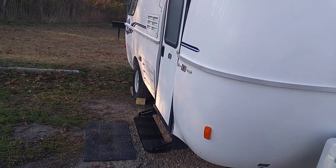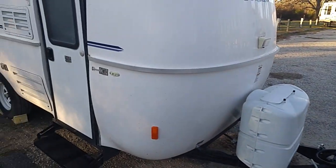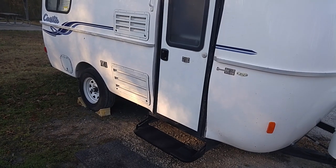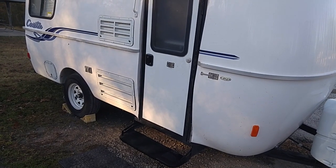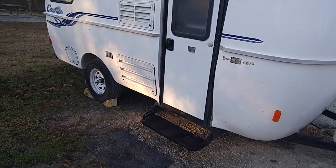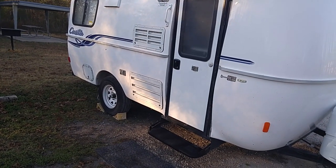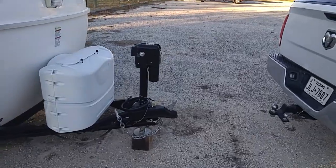The last thing: be sure you're hooked up to your truck — be sure the hitch is hooked up to the ball — before you remove the chocks. Even though it looks fairly level, if there's any incline a single-axle RV can cause you a lot of problems because it'll move. So just leave those little yellow chock blocks under the wheels until you are completely hooked up in the front, then move the chocks. With a double-axle travel trailer it's not quite as big a problem, but with a single axle they'll try to wiggle on you if there's any incline at all.